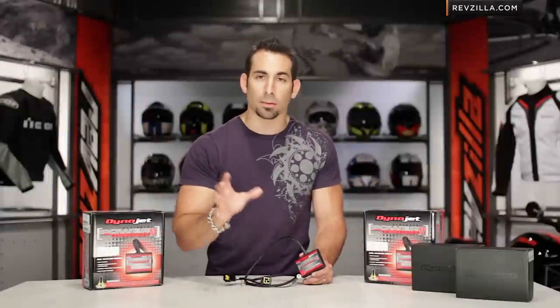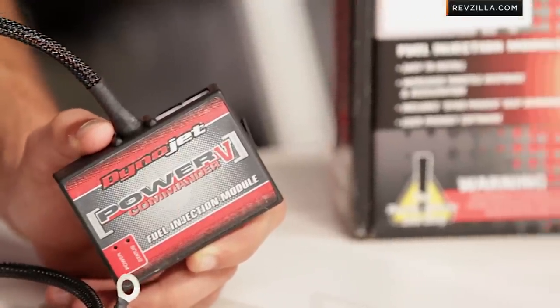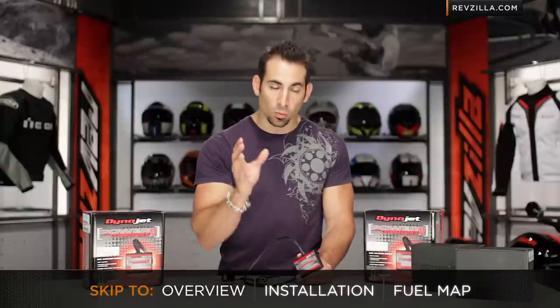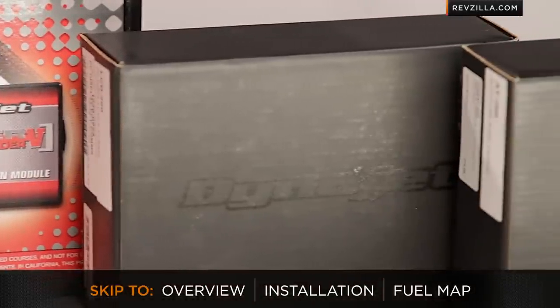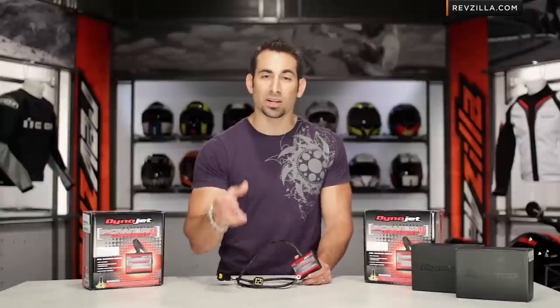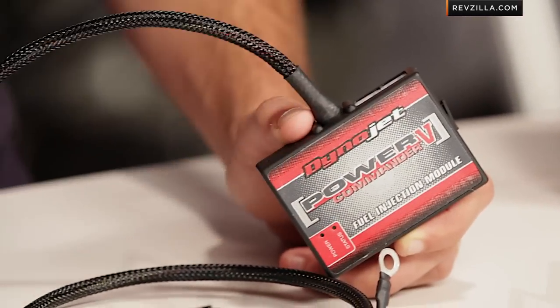In this video, I'm going to break down Power Commander. I have a Power Commander 5 in my hand. We know there was a Power Commander 3 that was its predecessor. We'll talk about selecting the right Power Commander, what you should expect from an installation standpoint and a setup standpoint, but first let's talk about why you would use a Power Commander. What a Power Commander does is it connects to your bike and sits in between your ECU or electronic control unit and your fuel injectors, so it optimizes the air-fuel ratio on your bike depending on how you're set up.